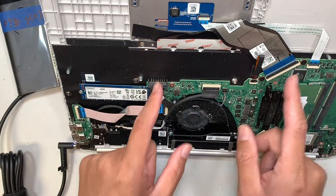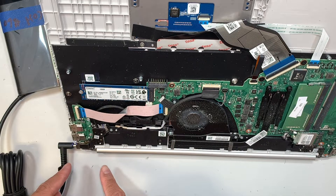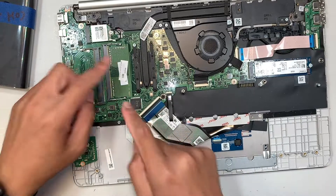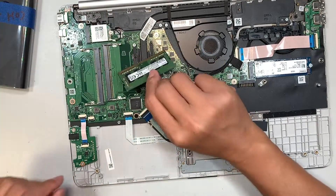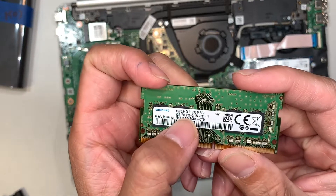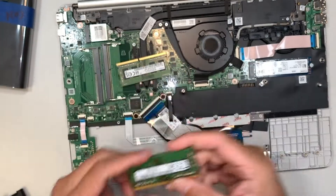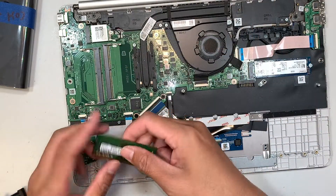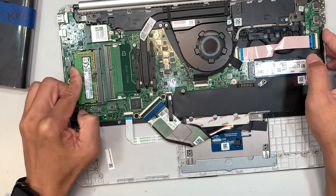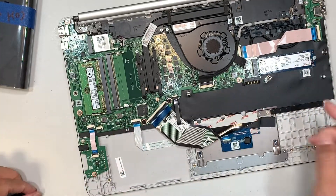Because it doesn't have the battery, it is not showing the orange light, but it's the same problem — it's not turning on. Let's try one more thing: remove the RAM. I'll get a replacement RAM. Here I have the DDR4 replacement RAM — how do I know? It says PC4, which stands for DDR4. Move the old RAM aside and try using the second slot.